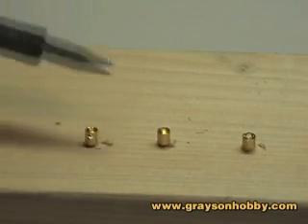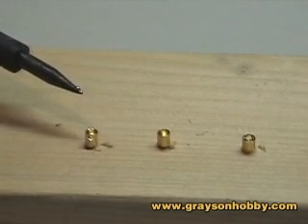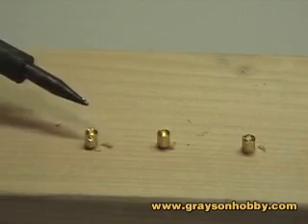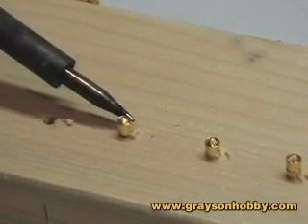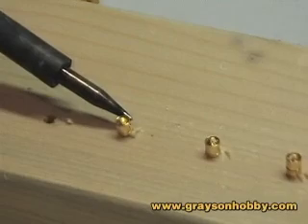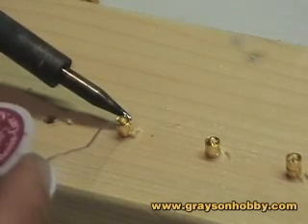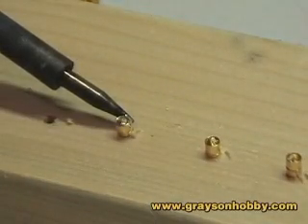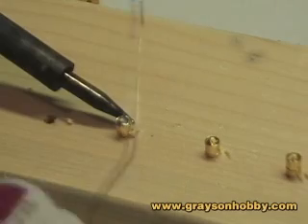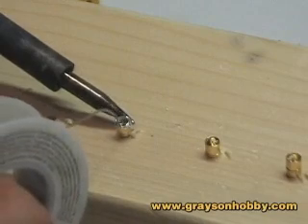What we're going to do is take the heat and heat up the outside of the bullet connector. What that's going to do is heat this whole area up, and then we're going to fill the little cup, if you will, up with solder. We'll put our heat on there, let it get nice and hot. We're actually going to fill this sucker up with solder — a nice little bowl of solder right there.